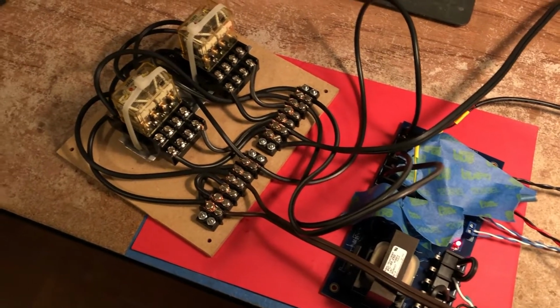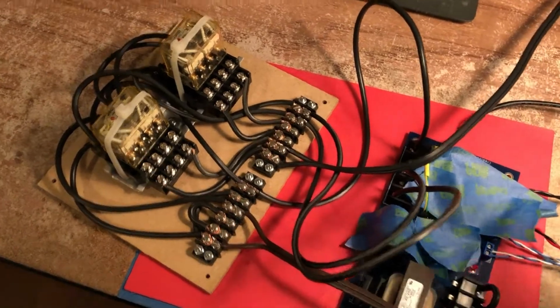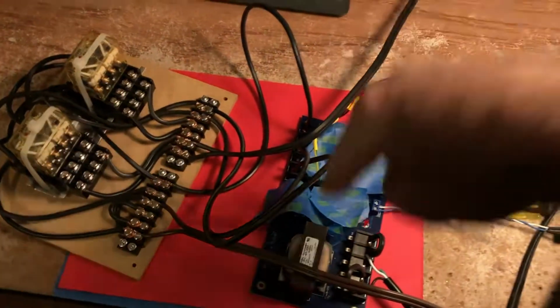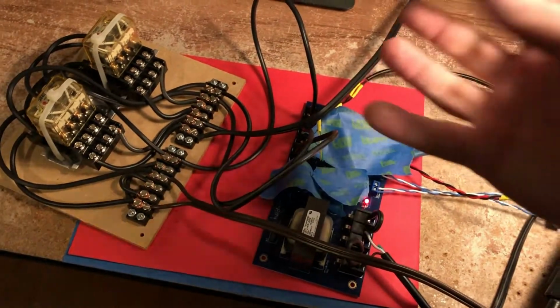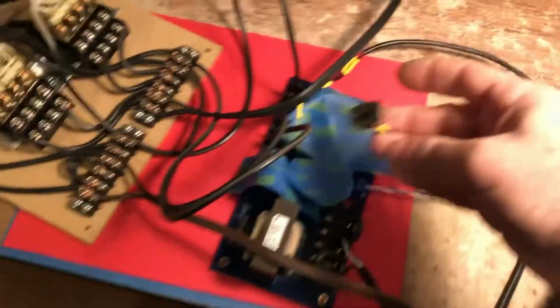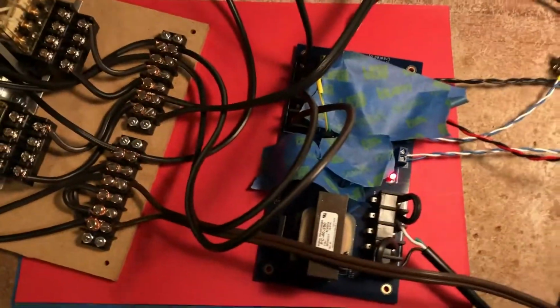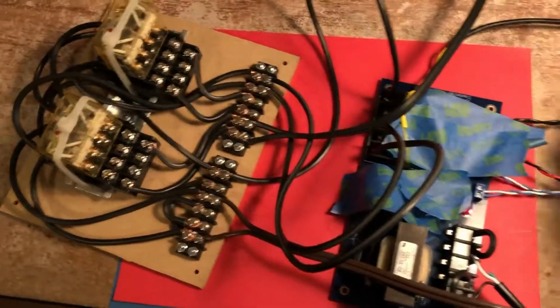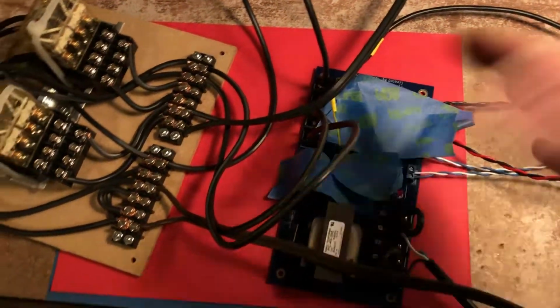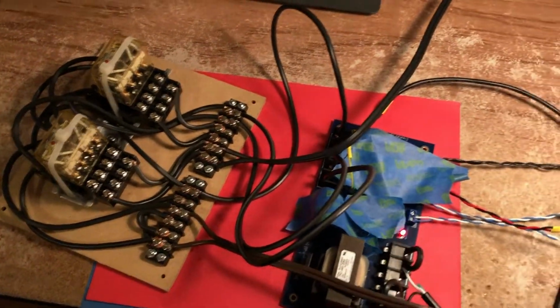That switch is multi-poled. It's a multiple throw, and two of them are opposite. So when you press it for the start motor, it disengages one of the poles, right? So the pole for the start motor is different from the pole for this, and they're actually inverted, right? So I get signal when there's no start button activity. I don't get signal when there is start button activity, and that is used by the system to determine whether the main coil relays should be on or off, right? So that explains all that.